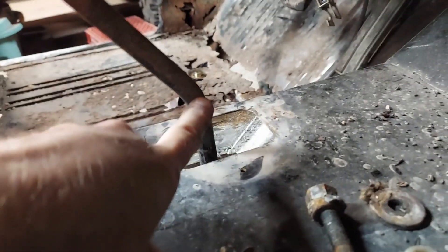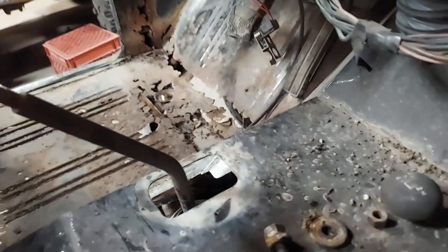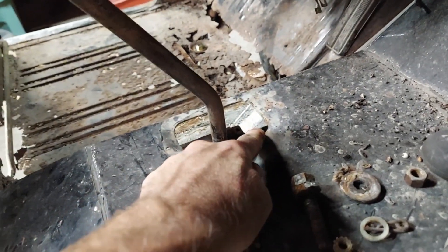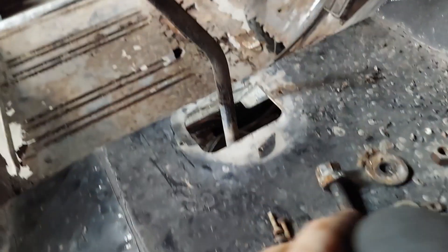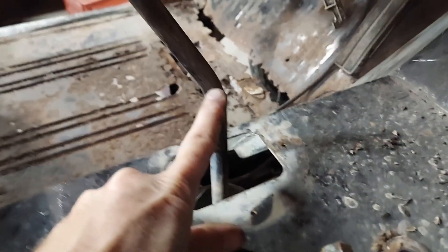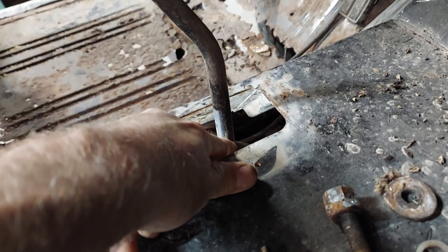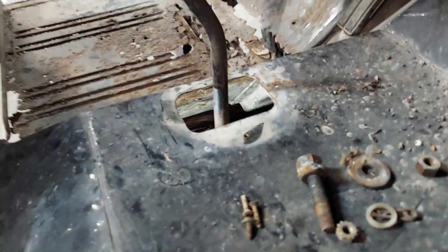What I'm going to do is straighten it out here, because with the body lift that I built for it, there's plenty of room. This is too high, so the whole front half of the hole is wasted — that would be four low right there, so again, the whole front of that is wasted. So once I straighten this out, I might go ahead and heat it up and bend it forward even some more, so that way I don't have to cut the hole out, I'll just bend the whole shifter forward.